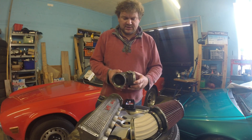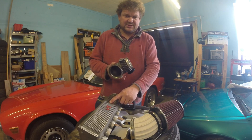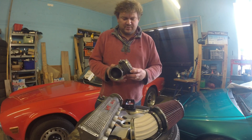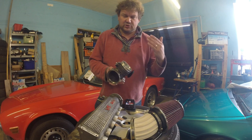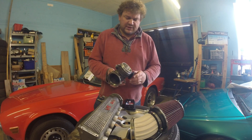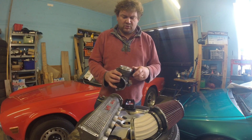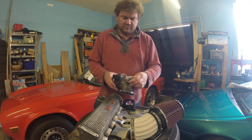That was great, but it brought some problems. It's for a V8, so it's oversized — 80mm bore, whereas the original would have been 65mm — so it's made things a little bit aggressive with the opening. It also turned out to be a traction control throttle body, sprung to open and cable-actuated to close to stop people falling into ditches, so I had to reconfigure it all, which brought additional problems.